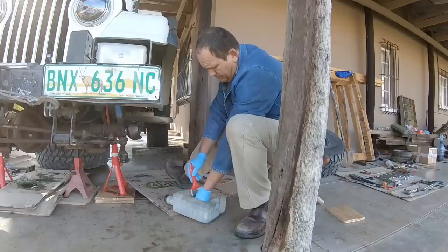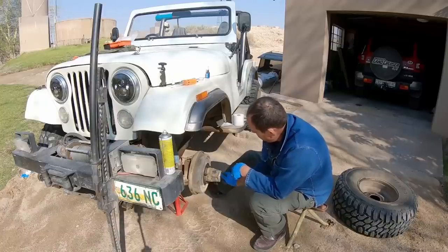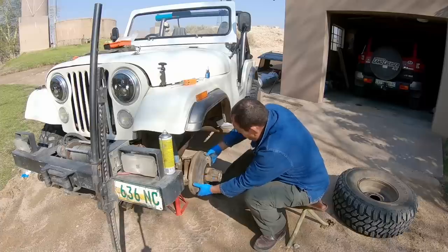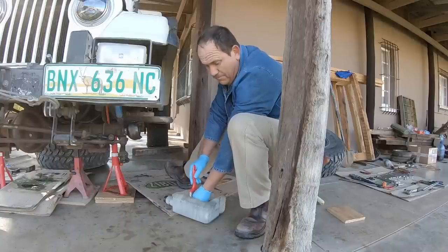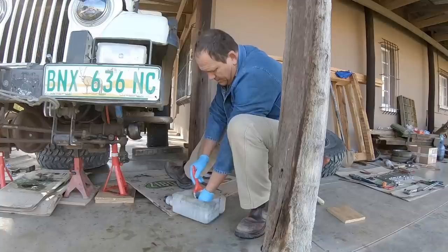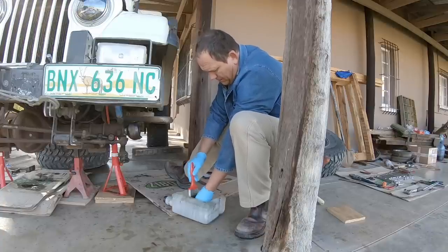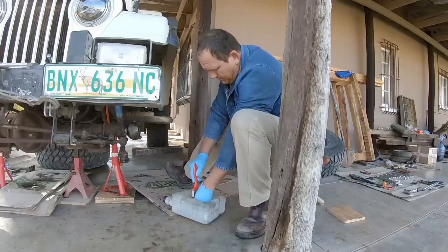After replacing all the bolts, I unlocked the hub. And then I re-locked it to check that it was locking, turning it, and it didn't lock. If I lock the diff up, and then connection down to the drive shaft, the drive shaft wasn't turning. So in my mind, it didn't lock. Some of you may already know where this is going, but let me tell you, I didn't stop testing there. I removed the hub, checked that everything inside was working, and that everything was working perfectly.